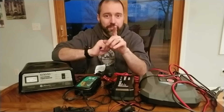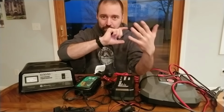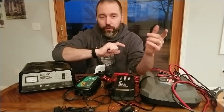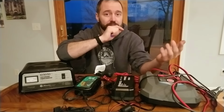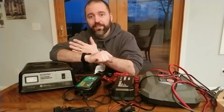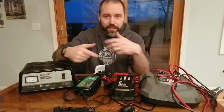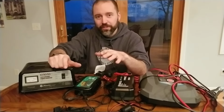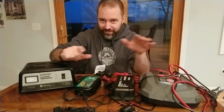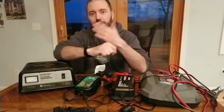But if you're trying to maximize it so it hits 100% without popping, that last bit, that last 20% roughly, you are going to slow down. You're gonna have to keep the same pressure basically, because the balloon now is trying to push air back at you, and that's called internal resistance if you were to apply that to a battery. The battery is resisting the charge, the chemical reaction. It's not wanting to convert electrical energy into chemical energy anymore. It will, it's gonna take a little while. But it's kind of like the same concept of a balloon trying to blow air back at you.